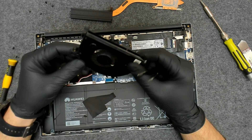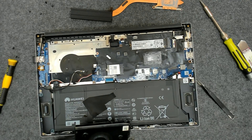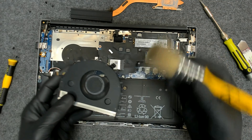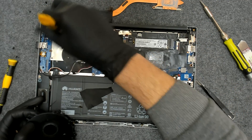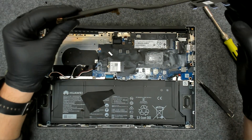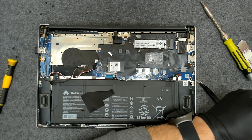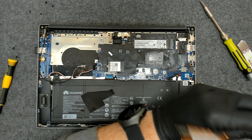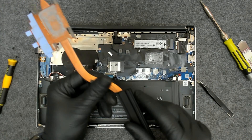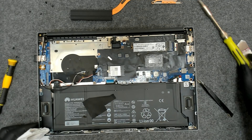I'm going to clean the fan a little bit with a brush. I did clean the fan using just a brush. We're going to clean here also. Now we have to remove the old thermal paste — let me clean the cooler grill as well with a brush. As long as you can see through the grill, it's okay.